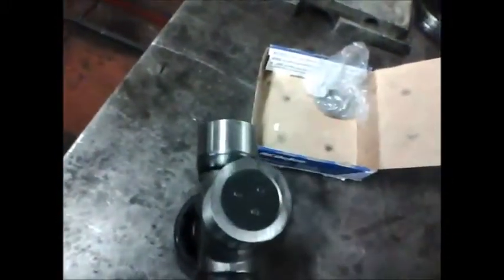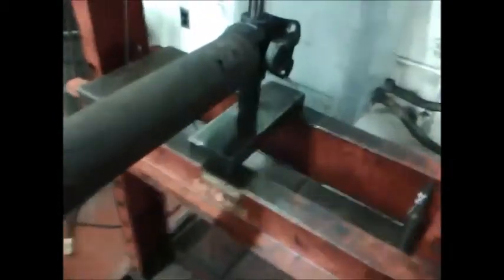In other words, if you looked at our universal joint, we've selected a socket that we can fit one cap into to allow the universal joint to slide down through the drive shaft. And we've selected another socket that's roughly the size of the cap to push the cap down with. So we're going to go ahead and push the universal joint through our drive shaft.